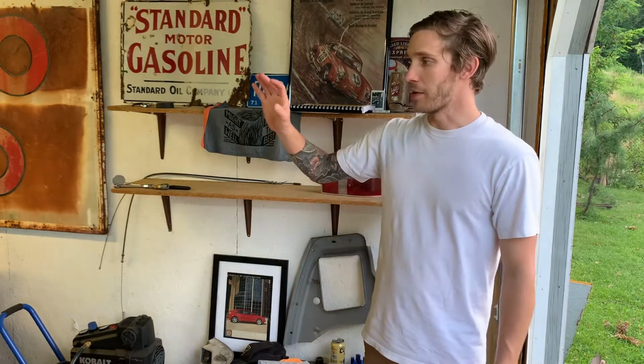I took my lock post off the jamb, and there's a ton of crust beneath it. The kidney plate was rusted in 3 or 4 spots, rusted through. The wheelhouse area was messed up, the frame. So this video is going to kind of detail how I went about repairing those and the sheet metal fab I had to do to fix them.